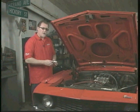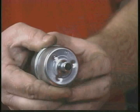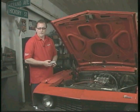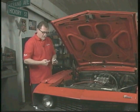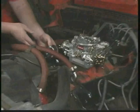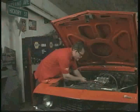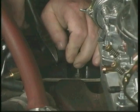Before we start, fuel filters are directional. If you look on the end of it, it has 'in' marked on one side and nothing on the other, so it lets you know which side is the inlet. When we place it in there, we want to be sure that the fuel is flowing from the fuel pump through this side toward the carburetor. We'll find a place on the fuel line to put this fuel filter — I kind of like this spot right here. In your car you might find another location, but for our car this is a nice spot.